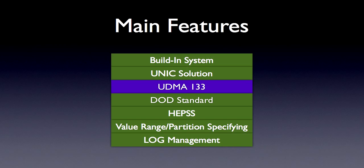UDMA-133. As we all know, the UDMA interface is grouped into different modes ranging from 0 to 6, each with its own specifications. UDMA-133 — also called UDMA-6 — is what DataCopyKing adopted, enabling it to clone image data at speeds up to 7GB per minute. This means while a regular disk duplicator takes 7 to 10 hours to finish a 1TB duplication task, DataCopyKing will only take 2.5 hours. What a tremendous difference.